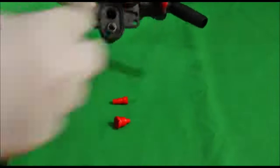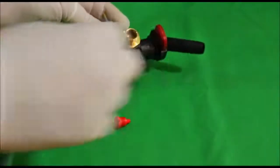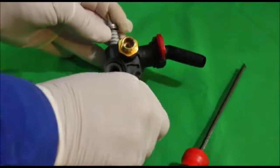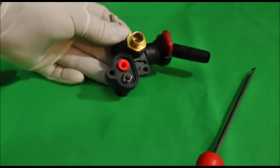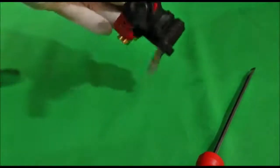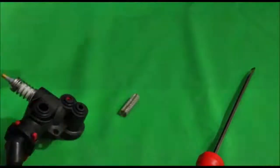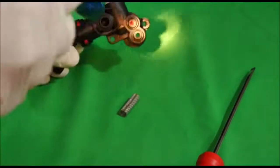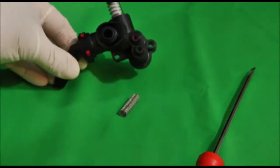For this to go back together, make sure you keep track of your injector screen. These are just threaded — thread the throat back in, then thread the nozzle back in. Now we'll go back and install that on the control valve. You've got three O-rings here — make sure these O-rings are in place, and if they're damaged, replace them.